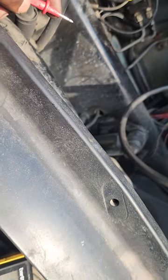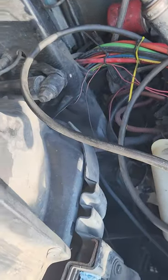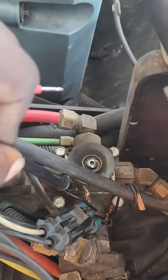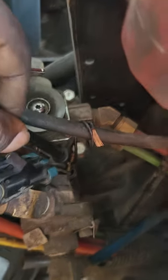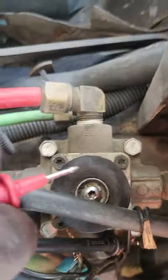The reason I know that is because I tested the original wire — I spliced it, but I'm going to clean it up better than this. I put the probe of the multimeter on continuity. Here's me probing it to the original wire which is here. This is the original wire that's coming from the firewall, which is back up in here. I got my ground probe on that and I'll find it — it's kind of hard by myself but I'm going to try my very best.